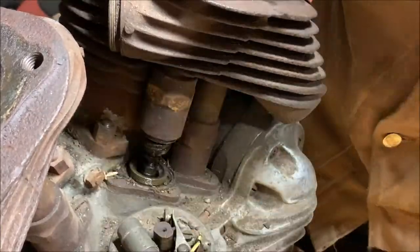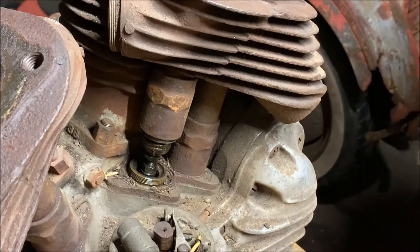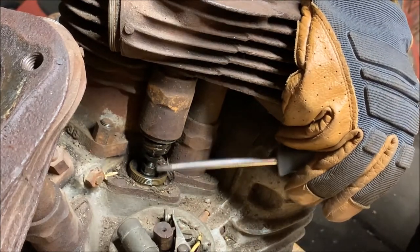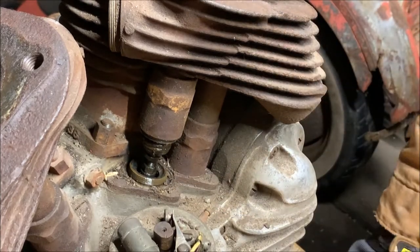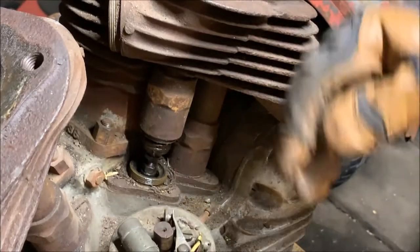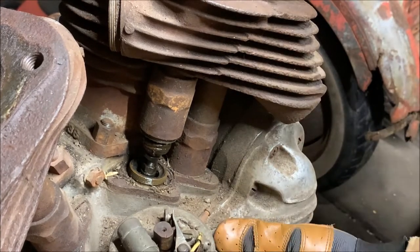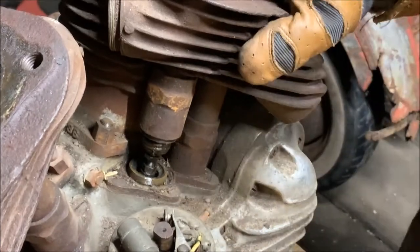Here we go. Now these lift up and out of the way. Now you can see the tappets. Sorry, I keep calling them tappets. They're not. We can see the valve lash adjustment screw, so a screw and nut combo here. So now back those off, and then this valve will be entirely free of the spring pressure. Well, it'll be entirely free of the cam lobe that's inside here. And there'll be no pressure, so then we can pull these off.